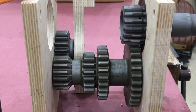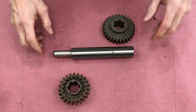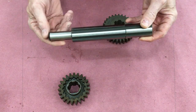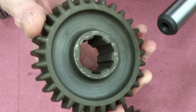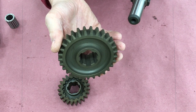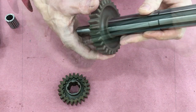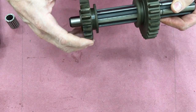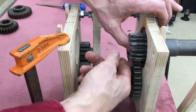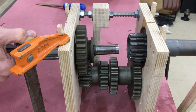The countershaft cluster gear is always spinning whenever the main drive gear is moving. This is the main shaft — one end is where the roller bearings go and two sliding gears ride on it. The one I'm holding here is low and reverse, and has six splines that match the main shaft. Second and high gear also has the same splines and it slides on the shaft as well. On goes the roller bearing, then the main shaft goes in. Slider gears go on — low and reverse goes on first, then high and second.